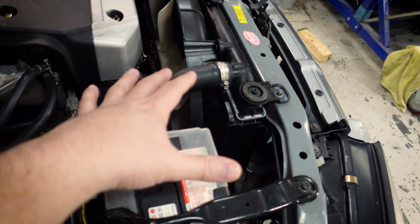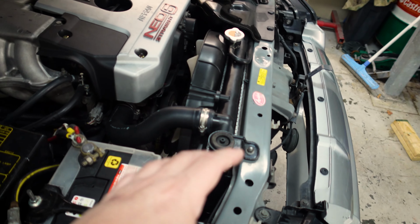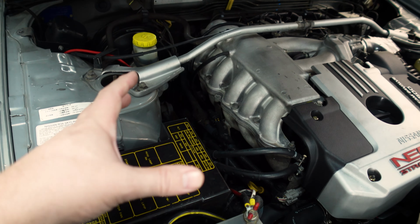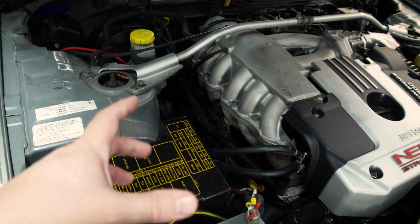But we also have a transcooler in the bottom of the radiator that has fluid in it. We have a series of lines. I don't know how much they hold, but they do hold some. We've got all of the fluid that gets stored in the valve body of the gearbox. And then we've also got the torque converter.